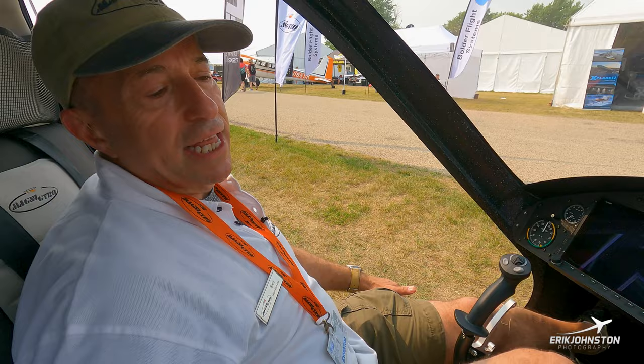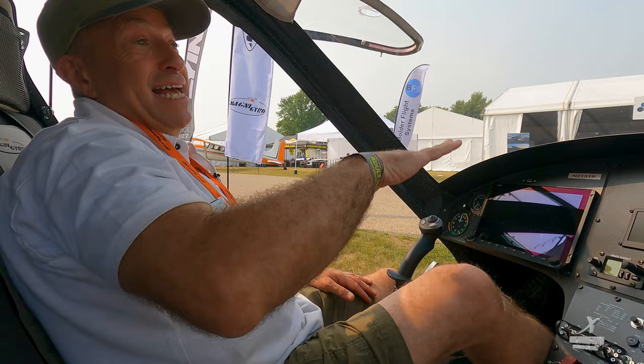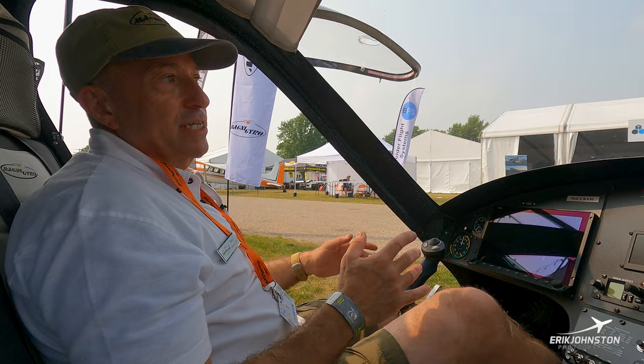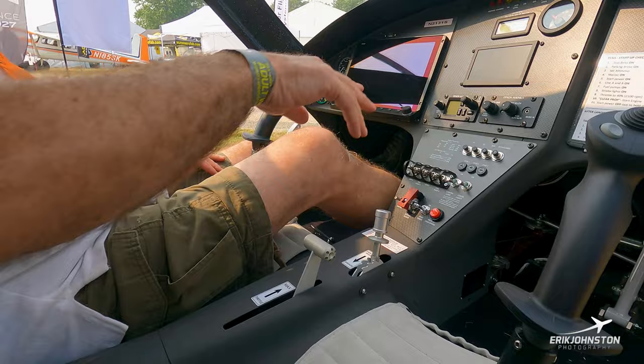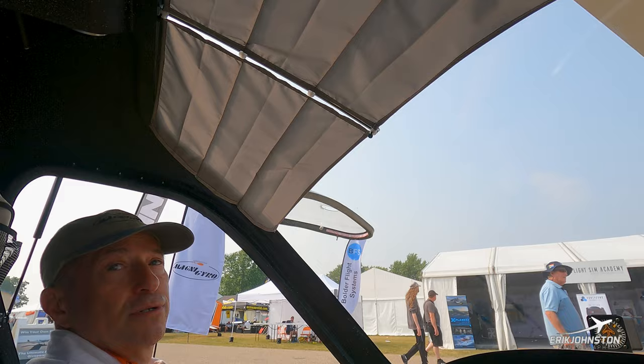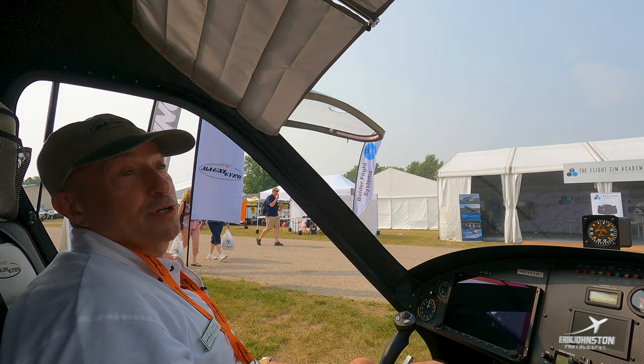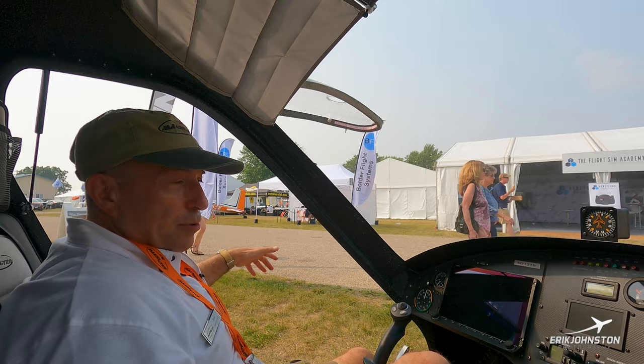Brakes on gyroplanes are never used in landing like toe brakes or heel brakes on an aircraft — they're only used for taxi. The reason we don't use them on landing is that with this massive rotor above me, if I tip it back it acts like a parachute, and the gyro just stops. That's one of the reasons we can stop the aircraft so quickly. We talked about the throttle, the sticks, and the compass. One beauty of this gyro: in this weather, you have to have a sunshade. It protects from the sun baking you and really causing you to overheat. With doors open or air vents open, flying is great — but it can get hot if you close the doors before takeoff. Normally we leave both doors up, and right before takeoff we pull the door down, latch it, and take off.